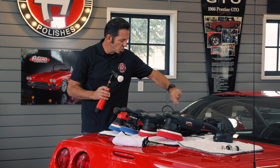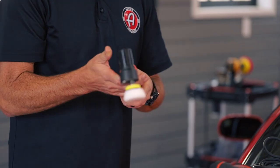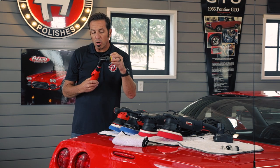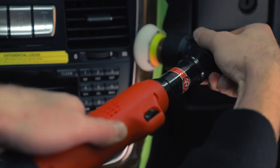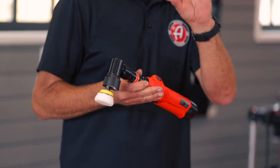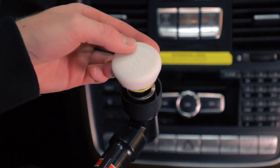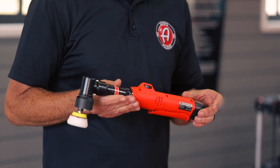Anywhere that's super tight where you can't get even the Mini polisher into, that's when you'll use the Micro. The Micro polisher has adjustable speed — you can change it from a rotary tool to a 3-millimeter orbit to a 12-millimeter orbit. This is for the really difficult-to-reach spots. It makes it possible to get 100% of your car to perfect. Another strong use for the Micro is the interior — burl wood, carbon fiber, scratched-up dashboard, door panels, center consoles. It's a very effective way to bring those back.